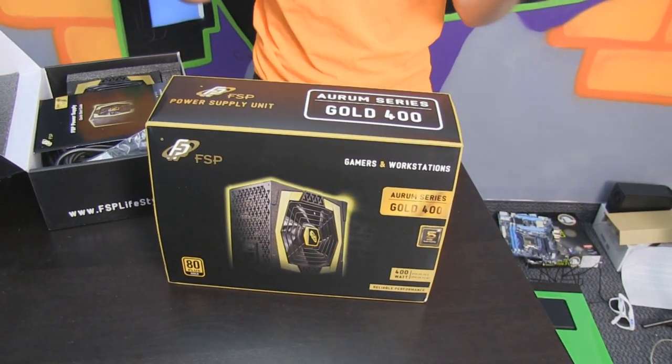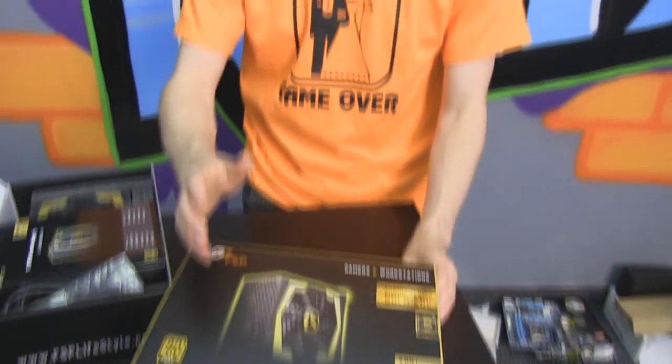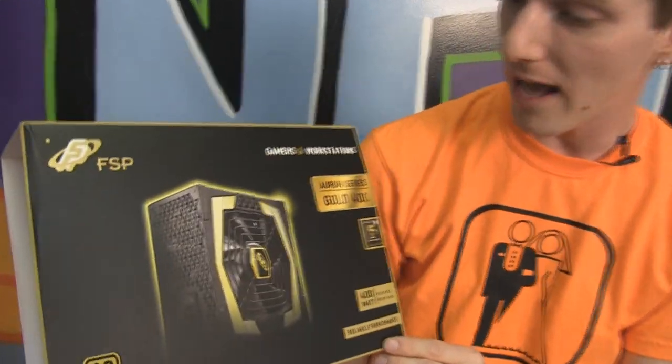What we basically do is we take a system, we upgrade it from a very, very basic configuration all the way through all the steps up to a very high-end machine, and then we discover as we go along how much power it consumes. What we found out was we plugged in a 1200 watt 80 plus gold power supply and power consumption sucked. The efficiency was no good because we were consuming so little power from it, whereas if we'd taken a 400 watt 80 plus gold power supply, we would have actually consumed less power as a whole.